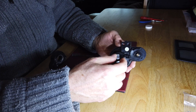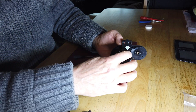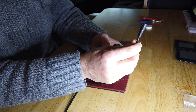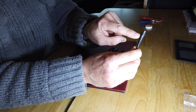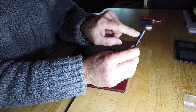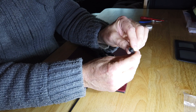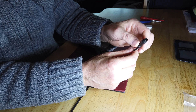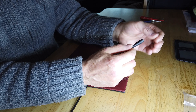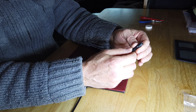This is the new thumb controller — the cable goes inside — and this is the original plug connector. There is a line which you line up with the plug on the other end of the bike, so it just pushes in. The pins are located so they can only fit in one way. It's a bit tight to pull off originally, but it's a very good fit and just clips on.